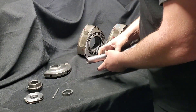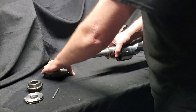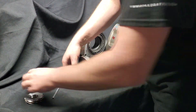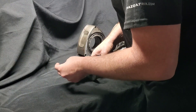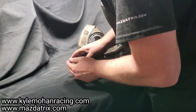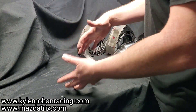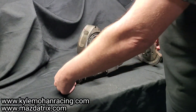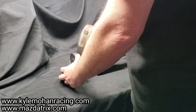Being careful of the shaft — you don't want to damage it. Main thrust plate, one spacer. You don't need any of the Torrington bearings; this is just getting the counterweight up off the shaft so you have appropriate stack height. Then we bring our counterweight and gear on, and then our drive. Sneak the keyway in — everything should be fairly free moving. If the keyway or any parts are binding, that could indicate a damaged key, damaged keyway, or a bent shaft. It's also good to check the shaft for runout, which we'll do at Mazda Trix. This assembly still needs a front pulley, so I'll be putting that on soon.